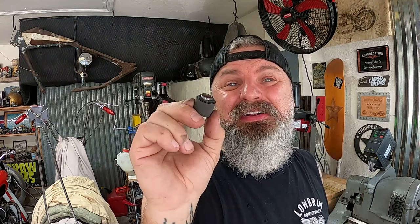Got that turned down nice and neat. Now we just need to get it pressed in — we'll use the same technique we did for pressing the tubes into the polyurethane. This time we're going to add a little bit of grease to the outside, which makes it easier to press in. When doing that, find a socket that is very similar in diameter to your bushing so that as it presses in, the rubber expands and holds it together, sliding in nice and neat.